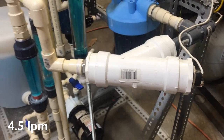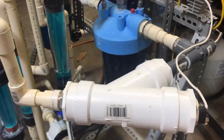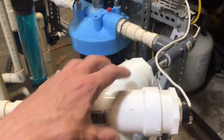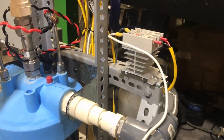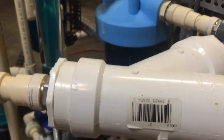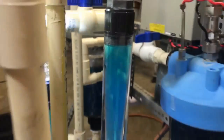I think a lot of that debris that we're seeing is coming off of this heating element. Those little specks of white material look just like the scale that builds up on the outside of these heating elements. I've got the wattage turned down to about 400 watts, so I was hoping to cool it off a little bit, but it's still showing signs of emanating that scale.